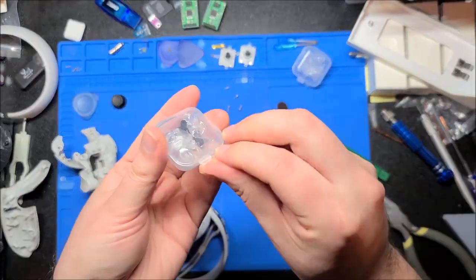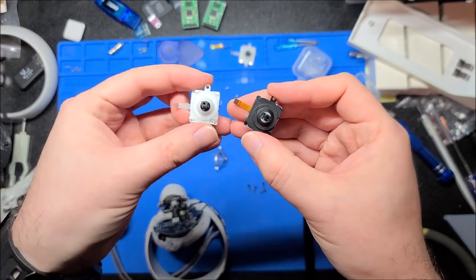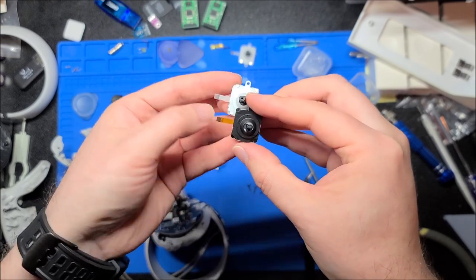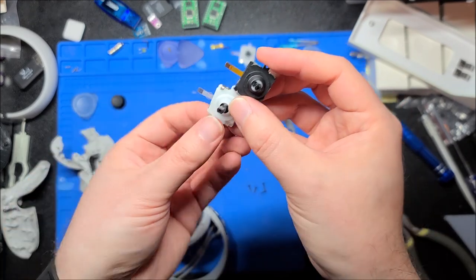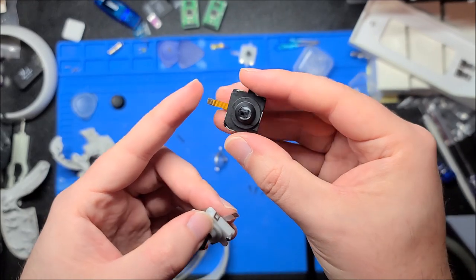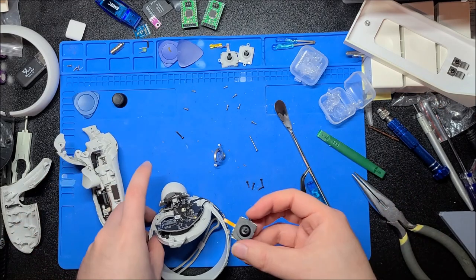Let's do a comparison. The new joystick is different — it has black plastic and the ribbon flex is the standard goldish color. The original stick has little wings on the flex cable that the new one oddly doesn't have. The original has what looks like carbonized pads while the replacement has gold plating. The back looks a little different as well.